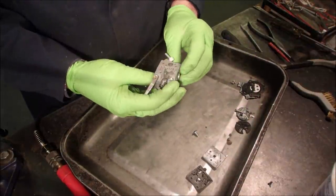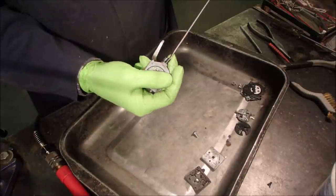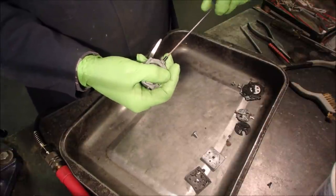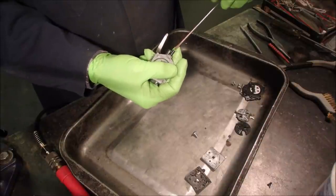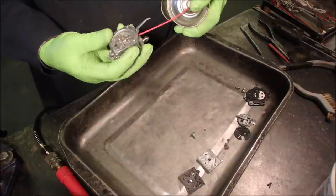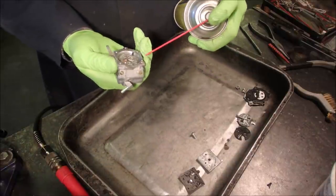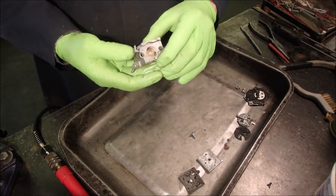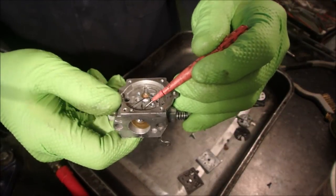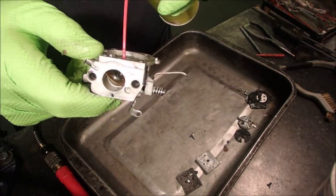So now, have we got everything off this carburetor? Oh, one more thing. Let's check this H mixture. So we'll see where it's at. Half. Oh, just over 3/4. That's all right. Okay, there's the needle. We'll just get some carb spray and spray it into that hole, through where the needle goes. And then I'll have to open the door here on this little throttle. There are three little tiny holes, 1, 2, and 3, that are opened up to the inside of the throttle body. And if I spray in there, you should see something, maybe not.